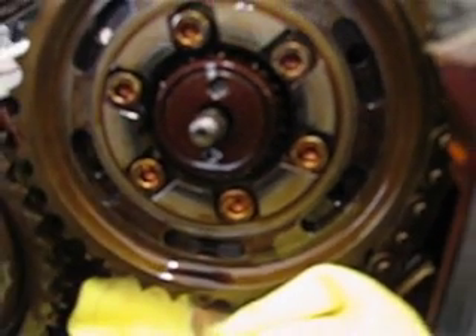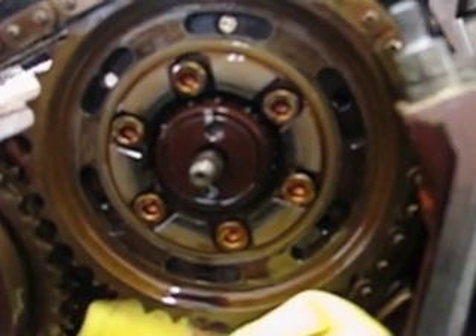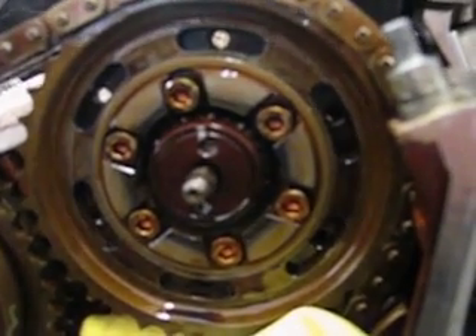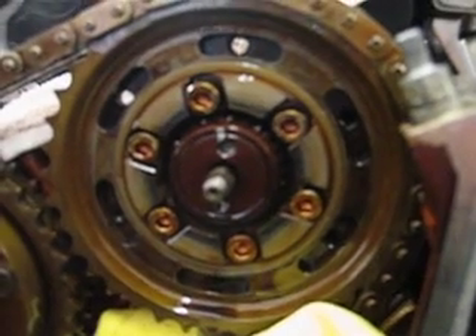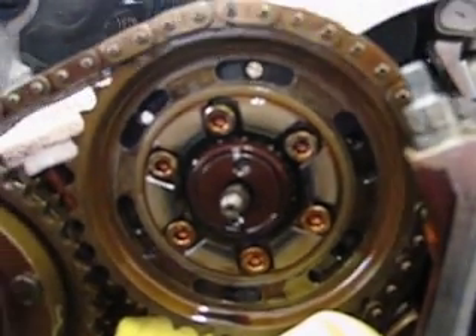So you've got six loose bolts on the intake side of this Vanos gear. I haven't taken off the exhaust side yet, but it appears that this is definitely a major issue. Had I not done this, who knows how long this would have lasted before it would have just blown up inside the engine. Pretty scary stuff.